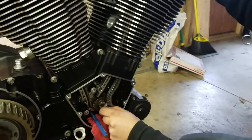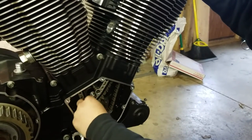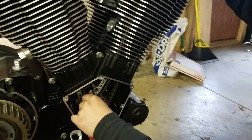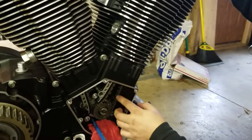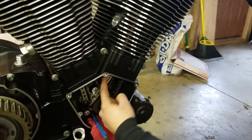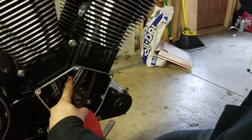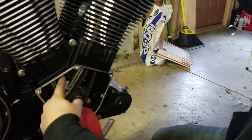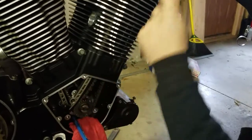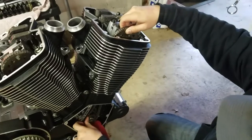What we're going to do is just kind of temporarily put this chain on. What you're going to want to do is make sure most of the tension when you go to time these is on this side, because when you put this inside of here, that cam chain tensioner is going to take the extra slack out of this chain. You can kind of see the slop here — when you push down on it, it's going to make sure all the tension is off. You'll want to get this turned and timed as evenly as you can until you go to put the rear one on.